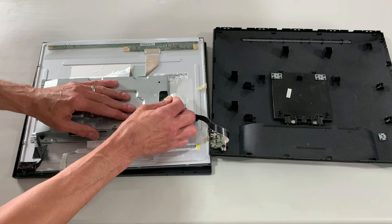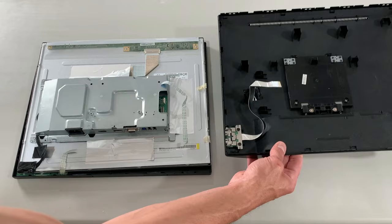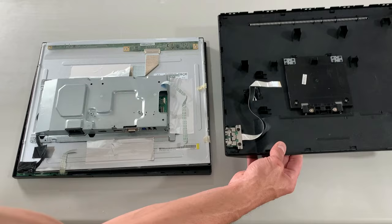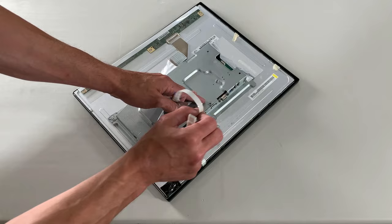Next up, remove the two ribbon cables — simply pull the small one out of its socket, then release the bail so you can disconnect the ribbon cable that attaches to the USB ports. As we continue to strip this LCD panel down, remove the ribbon cables and the housing on the back. Believe it or not, foil tape is going to be the main fastener holding things together.